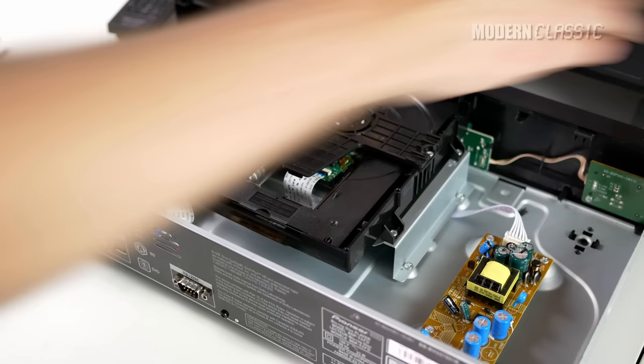I hooked it up and ran smack into another big problem: no sound at all when connected to the rear HDMI inputs of my receiver unless my TV was physically disconnected — not just turned off. Didn't matter what kind of disc was in it: DVD, Blu-ray, SACD, whatever. Strangely, it did work from the front input, so I knew the player itself was at least basically working, although sometimes it had worked perfectly and other times it would click on and off every 10 seconds or so.